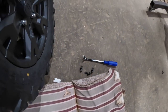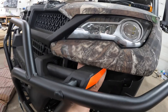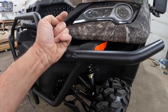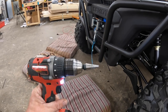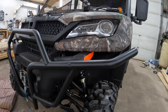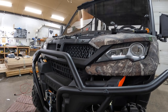There are three quick rivets right here — that's the tool we use, a good one for us. You're going to want to feel behind and make sure there's one brace here and one brace here that you definitely want to avoid. So I'm going to slide the hole just to the other side of that. We use a three-quarter inch step drill to make the hole. All of our lights, whether big or small, are three-quarter inch.